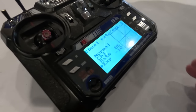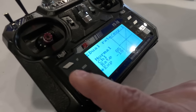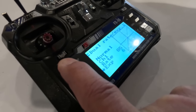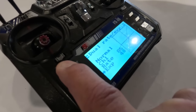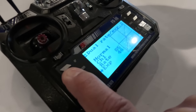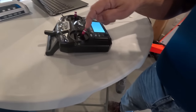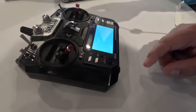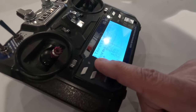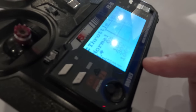And the reality is, for these little boats with these giant rudders, that's way overkill, right? So you decrease, or you increase the exponent to make that thing look, oh, I'm going the wrong way. I was right the first time. You decrease it to make that thing as least sensitive in the center. The throttle doesn't self-center, so it works slightly different. So there's a different setting for that. And this one, you have 4 data points that you can create a custom curve. And you'll see.